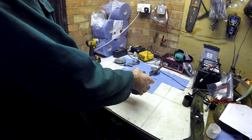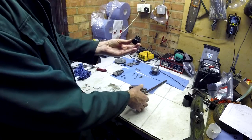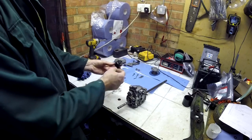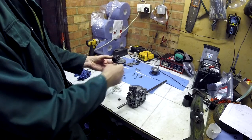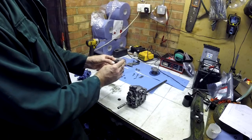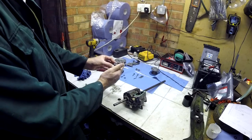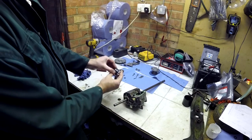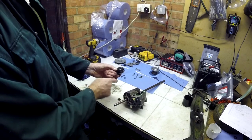And when you do that, you should reveal all of the pistons of an actual piston pump, variable displacement. So this is driven by the engine and rotates with the input from this pulley. And if a plate located in here remains flat, the pump doesn't do anything. But when the plate is at an angle called the swash plate and this rotates, it begins to pump oil between the input chamber and the output chamber.